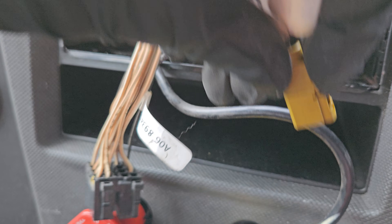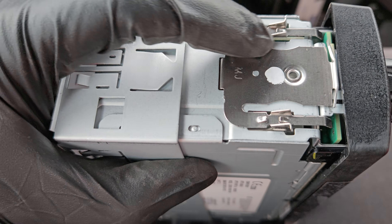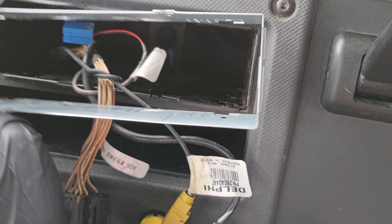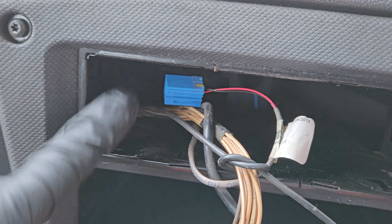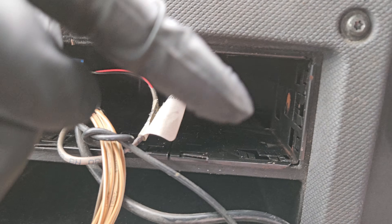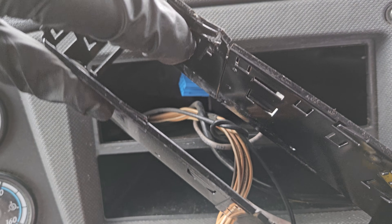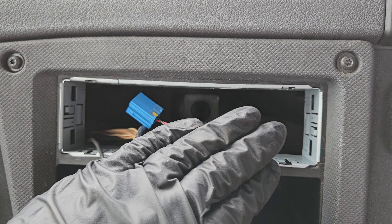The old busted one is out. There is a pinch point on this one — press in there and then pull it up. These are not fun to get out; I kind of messed my fingernail up. You've got to pull up straight while also pressing down on both sides. The new carriage has teeth that pop in, so push it all the way in and it will stay. Make sure the lip is on the outside facing you — don't try to shove it in the wrong way or you'll cut your fingers. There are some pins pressed down; use a small tool or screwdriver to pry those up. Press evenly on all four corners and slightly rock it to get it in. Don't press too hard in one spot — you can slip and cut yourself.